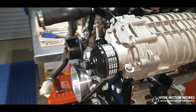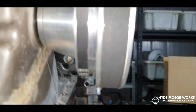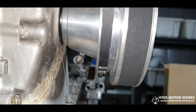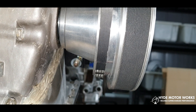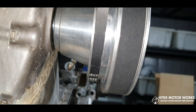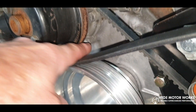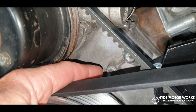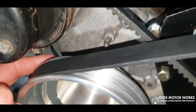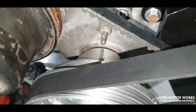This crank pulley here is one of the prototype ones. As I said earlier, there'll be provision just behind the notch of the smaller V-belt — that's where you can mount a crank trigger wheel at your leisure. The clearance in there will be just behind the water pump pulley and in front of the timing mark indicator. There's plenty of space to put one that can be perhaps 20 mils greater in diameter than the outside of the rear V-belt.